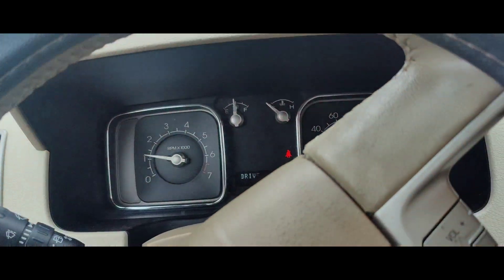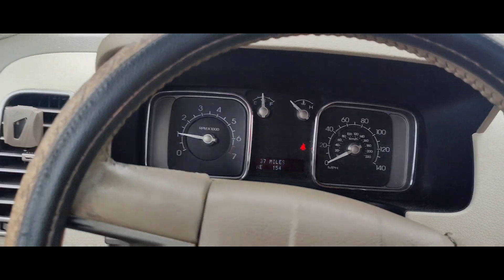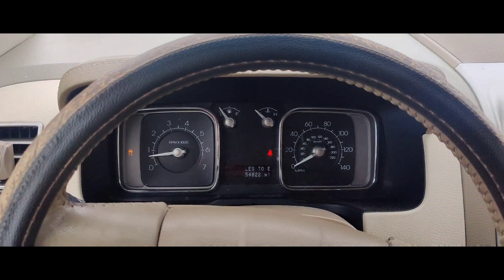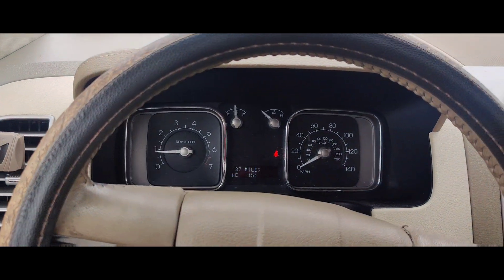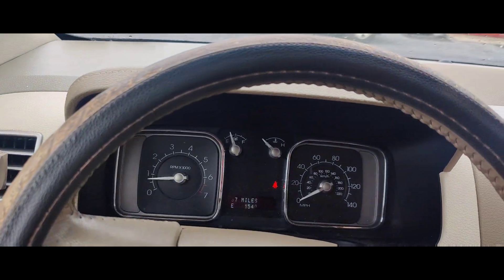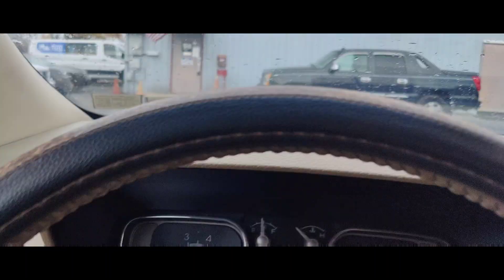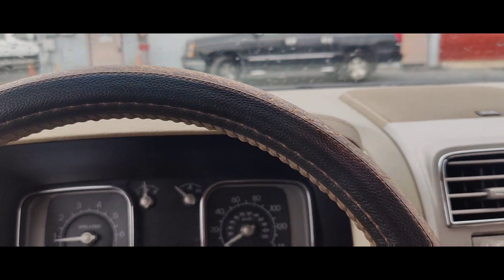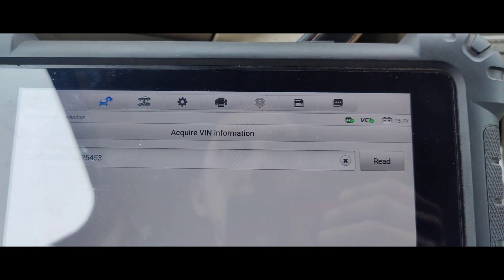Let's see what's going on here. They had a new alternator put in. The gauges just went out and came back on, and we had the traction control light flashing. They went out again. Kind of curious what our battery voltage is. Look at how they keep going out. What does our interior light do? See how it's flickering — there's our traction control light and everything. Let's see what our battery voltage is.